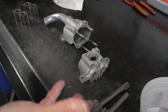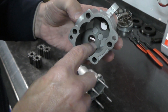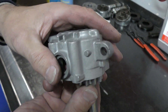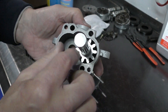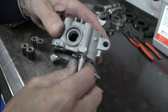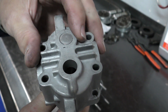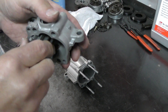With just the gears alone, it's time for a new pump. But let's assume the gears were reusable — the next thing to look at is the end housing. On the pressure housing, I'm looking for any heavy scoring or a substantial lip on either side. The other important thing is that when my shafts slide in, the tolerance here is nice and tight. If this elongates or wears, the shaft will move up and wear into the housing, wearing out the gear and the housing and causing failure. This one actually feels pretty good — nice and tight on both sides, very small movement.